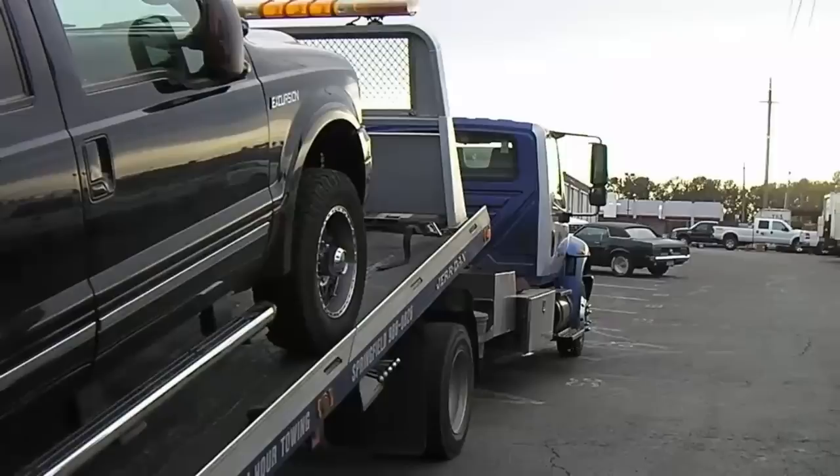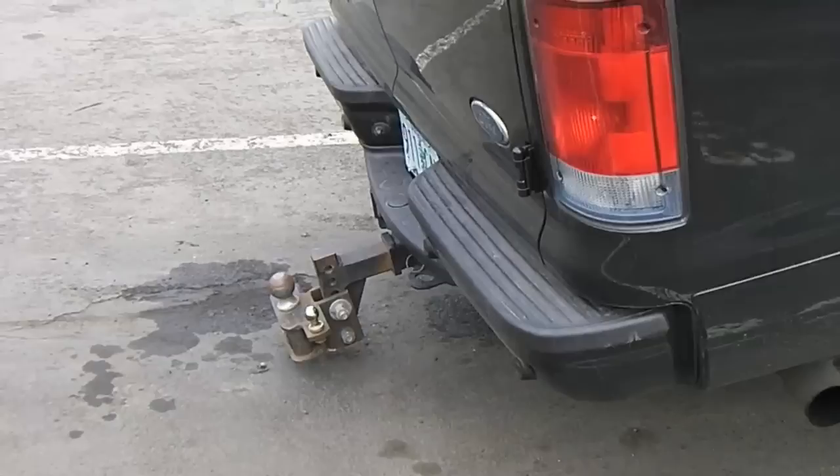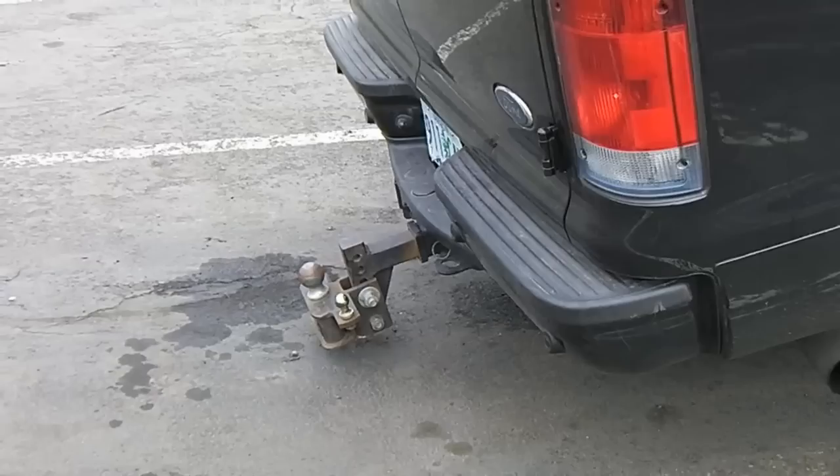Put the brake on — I'm telling you, do this every time. My tie-down straps are still on securing the vehicle. Don't walk behind the vehicle if it's in neutral and no tie-down straps are on it. In this case I've got it in park and the brake on. This is the kill zone — they call it that for a reason. Be safe. I'm not going to walk back there until I know it's not going anywhere. Then I'm going to get my skate.